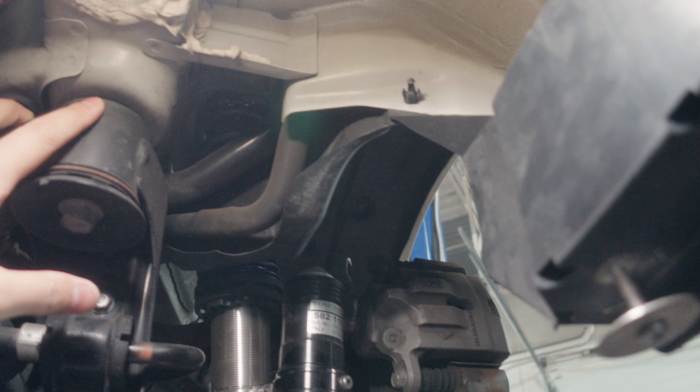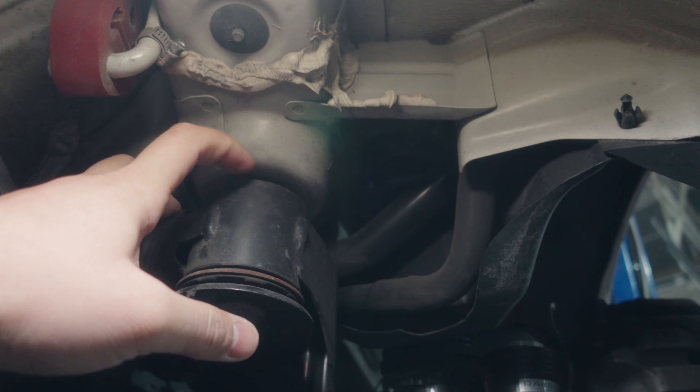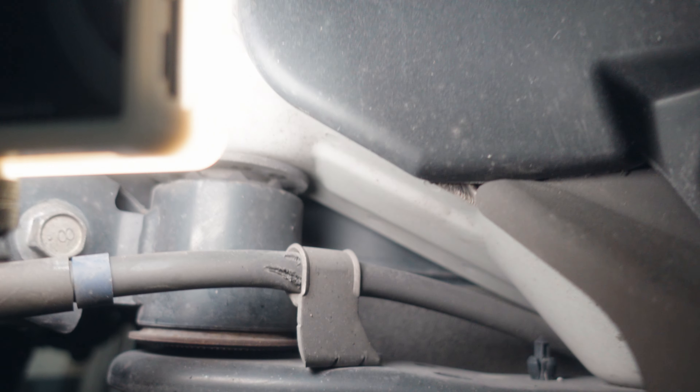It is a bit of an involved process. So if we take a look at the underside of the FR-S, here is where the subframe is mounting to the body of the car. You'll see there's actually a bit of space taken up by bushings at the top, and we can see at the front mount how there's a little bit of a gap being taken up. What we're going to do today is drop the subframe, press out the old OE rubber bushings, and press in solid bushings. Solid bushings are probably not something you want if you're still driving the car on the street — it's going to create noise, vibration, harshness, and put more strain on your suspension. But it is an available aftermarket option to help us raise our subframe and correct that geometry.